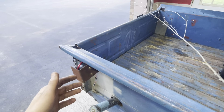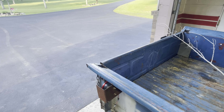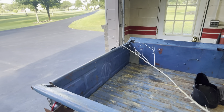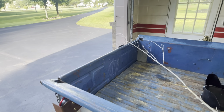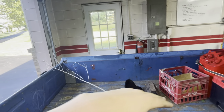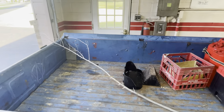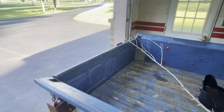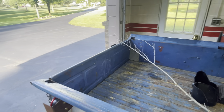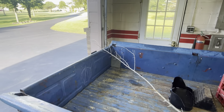A guy pumping up his ATVs warned me I was leaking fuel on the bottom. I know there's a hole in the tank but I'm not worried about that — the leak is from the gas lines, which are all rubber. Kaiser gives you a fitting for rubber hose rather than a steel line thread, so it was leaking from that. Since the tank was full, I rolled the Jeep off the hill and bump started it rather than risk starting next to the pump. Down the road it stopped dripping, and confirmed full with the stick.